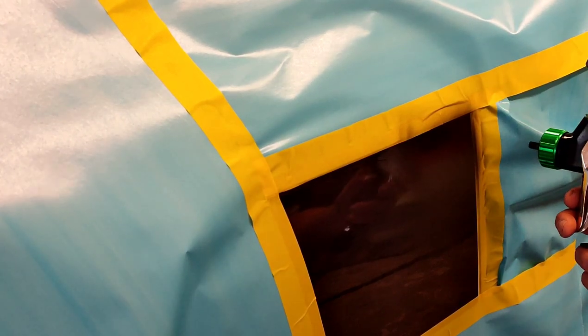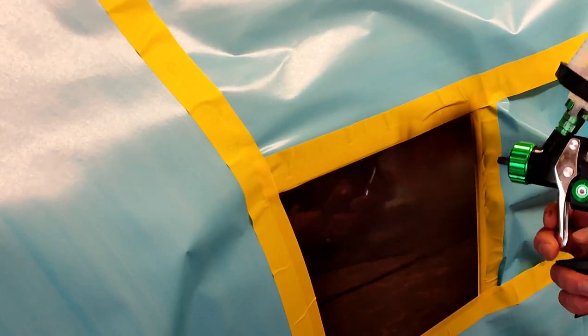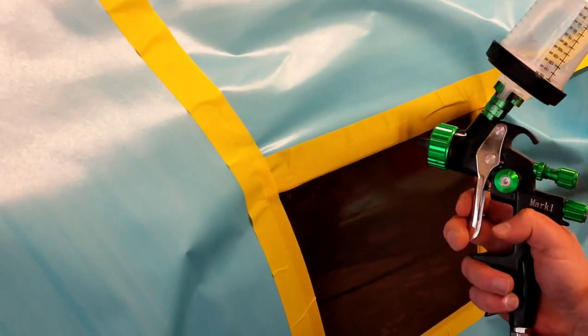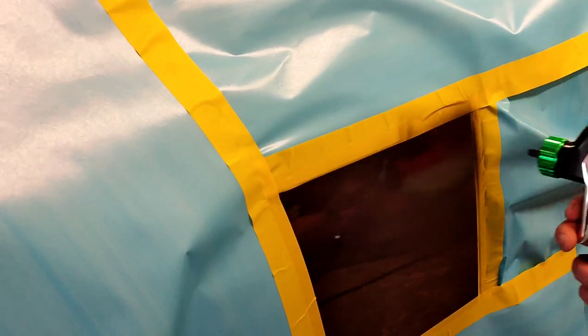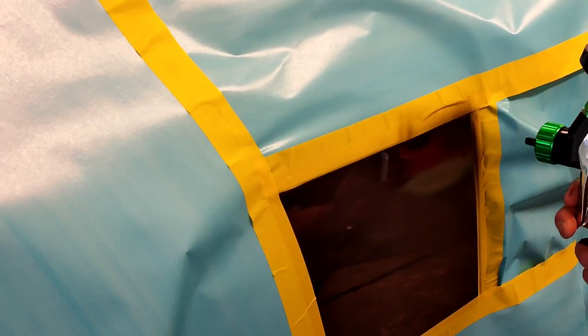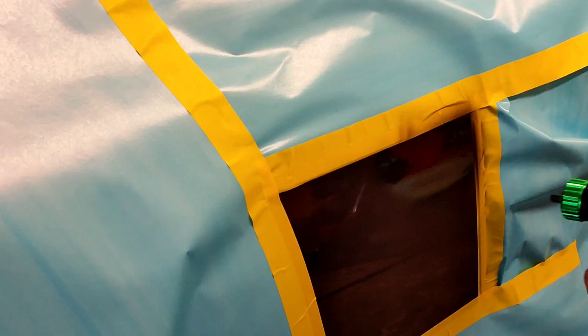Make sure we don't get any runs — it's coming out beautiful, we got full coverage with our base. Now moving along to the clear coat, pretty much the same exact process as far as how much we're going to pull back on the trigger — just a little bit more for the clear coat process. We're going to go for a little bit of a wetter finish. You're going to take that clear coat right to that 2,000 grit line, and maybe just a centimeter or two over it. All the 2,000 grit scratches are just disappearing — the clear coat is basically filling them in. We're going right to that line before we burn it in with our blending solution.